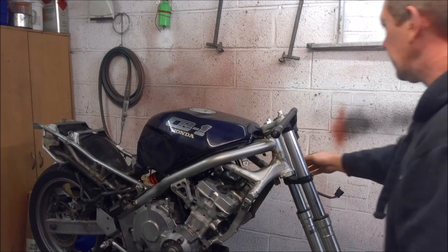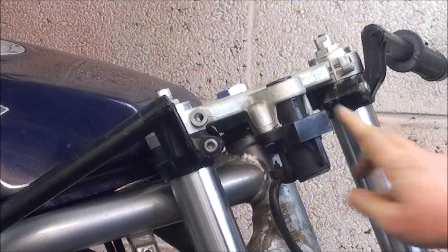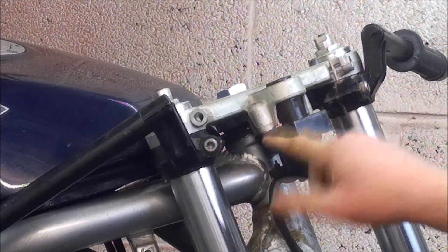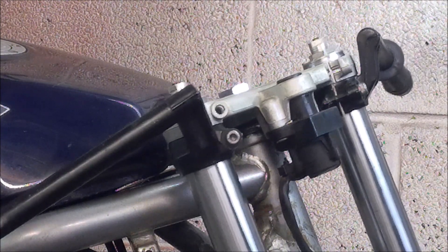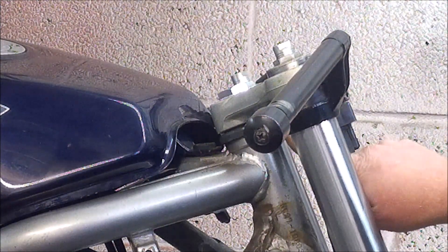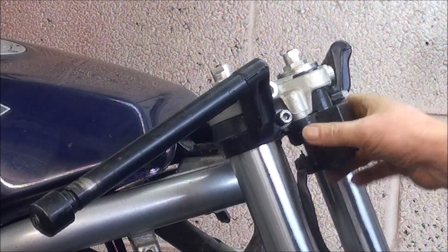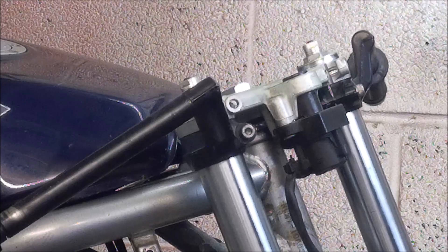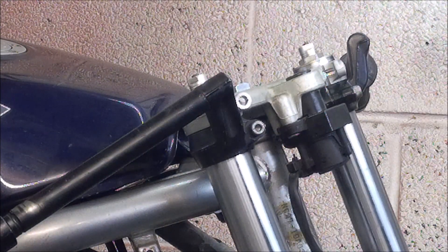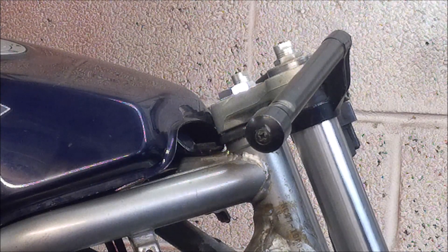The other thing I did whilst we were locking up the front yokes is I fitted the ignition barrel. This is the stock CB1 ignition barrel, and one of the advantages of using all Honda parts is it literally bolts straight up. The only downside is, turning the handlebars, it just catches on this little metal tab — there is actually a metal tab welded to the front of the frame which acts as your parking lock, and it just gets to about this far and then it rubs. So I'm going to have to just dress that back a little bit to make some clearance — but that's not a big deal, and that's why we do the mock-up.